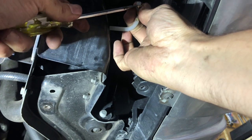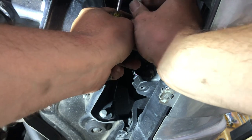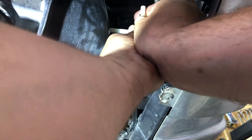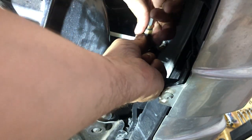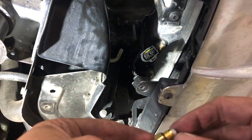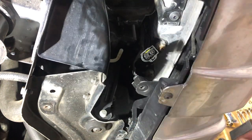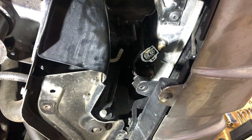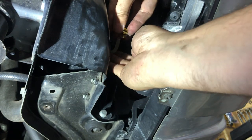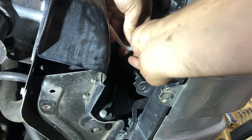We'll remove the old air fitting — the pressurized output fitting. You just get a screwdriver and give it a slight twist on that retaining collet and the old fitting should slide off. There we go. The new fitting comes with a plastic insert just to hold everything in place prior to installation. Take note of the collet — it's the reverse procedure of removing the other one: slide the fitting over the line and then put the retaining collar on.